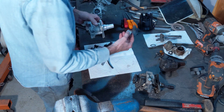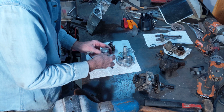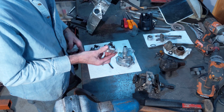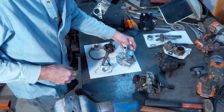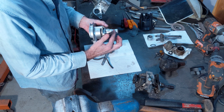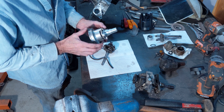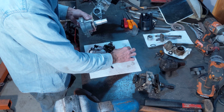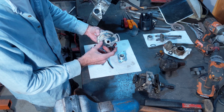The snout wouldn't go down inside all the way, so I just cut it off and sanded it a little bit — now it slides right in nicely. The next issue was that the snout on the bottom of the Z22 distributor is a larger diameter all the way down, so it would only go in about an inch and then get stuck. So I did a little backyard engineering: I shaved the snout down diameter-wise enough so that it will fit in here. I took the appropriate-sized hole saw — an inch and an eighth — and went down the outside to the depth I needed to clear the inside diameter in the cover.